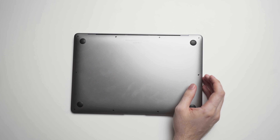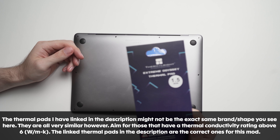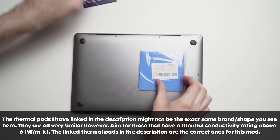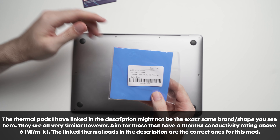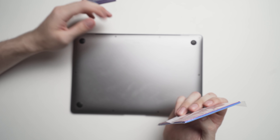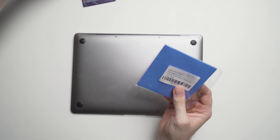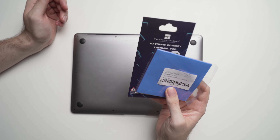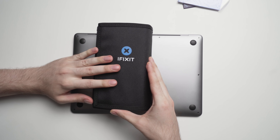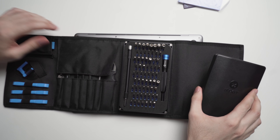You will need some equipment and tools for this. I have some thermal pads from Amazon — this is the 1.5 millimeter one, which is going to go on the top section because this is the thinnest. Then we've got a thicker 3 millimeter pad, which is going to go on the recessed portion. The aim is for these pads to make a connection between the heatsink and the back aluminum case. I'll link these in the description below. The other thing you're going to need is some kind of screwdriver set. I've got the iFixit kit here — it's got pretty much everything you're going to need, including all the screw heads, though you're only going to need one for this mod.